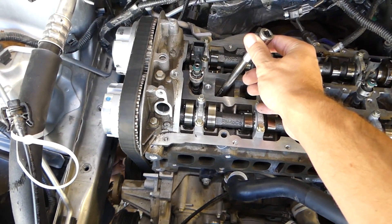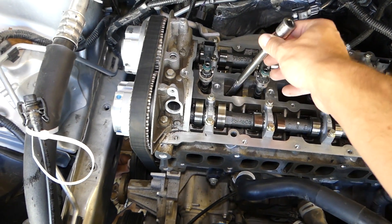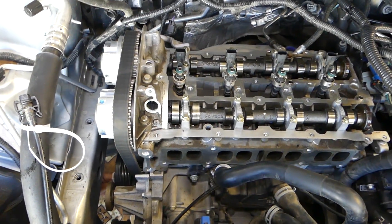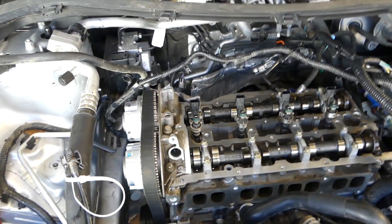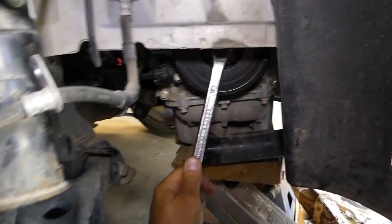Watch how the piston is going up — and this is the farthest up it can go. After that it would start going down, but in our case it can't because the pin stopped the engine at top dead center. Now do not spin the engine backwards, but we're going to do it for the video to show you what happens when you hit the pin.